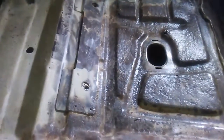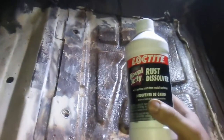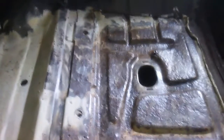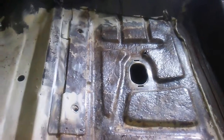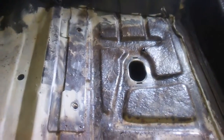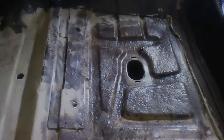I've got it cleaned up, vacuumed, wire wheeled, and ready to do the naval jelly rust dissolver. I'm going to put this on there to get the rust off, then clean it up real good and come down with the Van Sickle rust inhibitor primer. Once that's cured up I'll come down with a satin black from Project Gym — I've got some of that left — and put that on there as well to seal it up good and solve this issue.